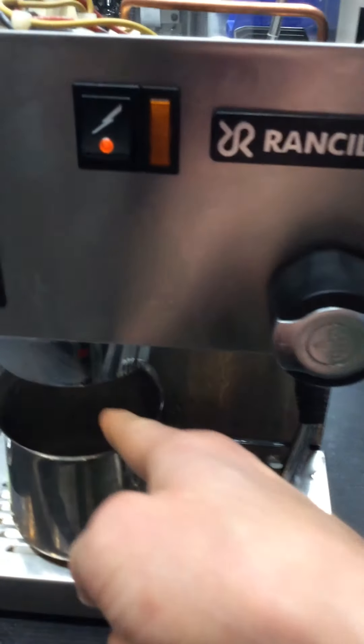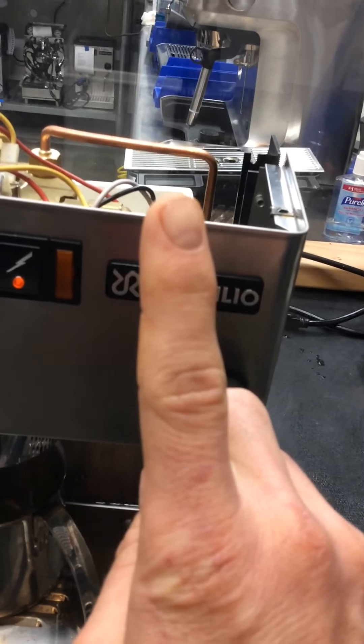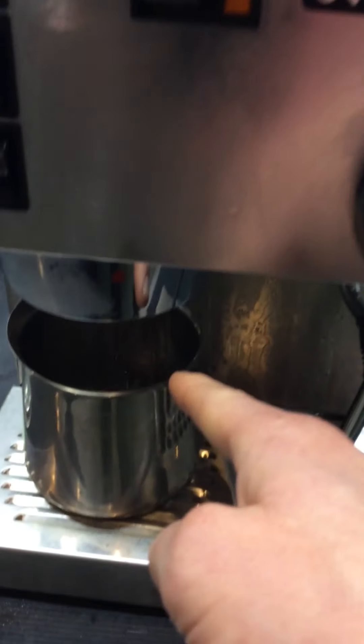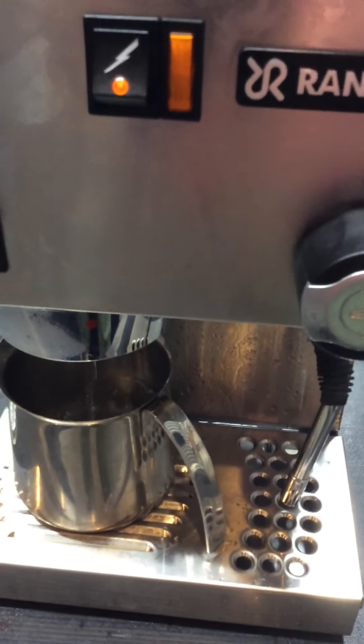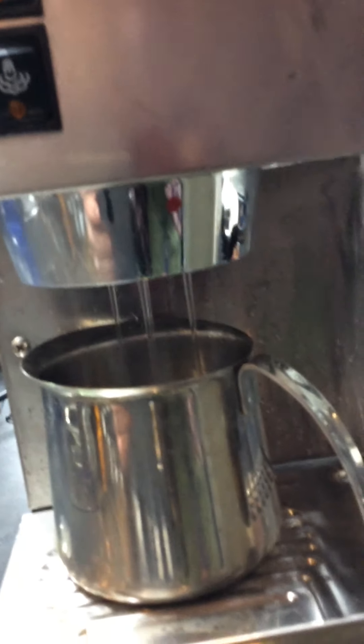The water will not come out of the boiler — there's a tube about the height of my fingers — and water will not come out until it rises above that tube. So as soon as you see water coming out of here, you know the boiler's full. And once you see it's going without a bunch of steam, you know you're cool enough to make coffee.